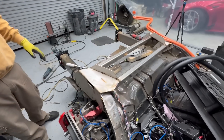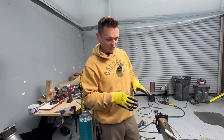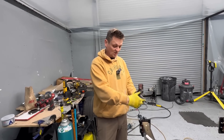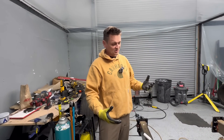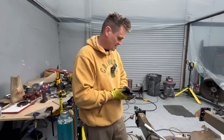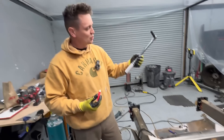Putting it back in place was not easy — we went back and forth for literally half an hour. I had my son jump on it over there and we finally got it back in place. I thought I had twisted it because of the massive heat from welding everything from the bottom, but apparently not — it was just how tight everything is. You really have to get it into its correct place. Next step: high strength thread locker gel and torque it down.